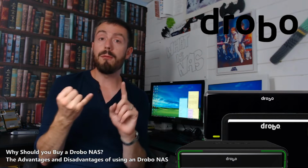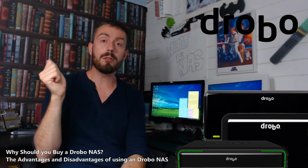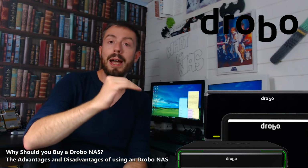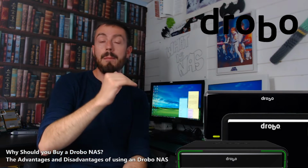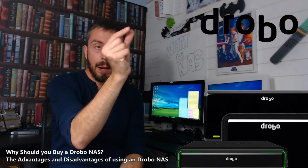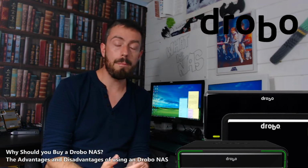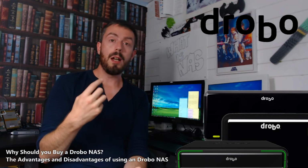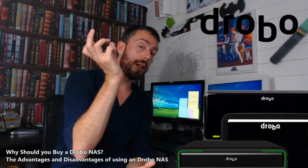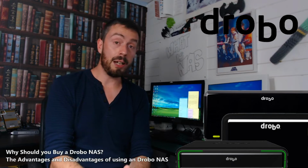And also, failure. Normally in a RAID array, when you've got multiple drives and a drive dies and you remove that drive, your read and write speeds will dip from around 90 to 100 megs per second down to about 8 to 10 megabits per second. Now, with a NAS, that means it's still working, but the system is using that parity that's been created to protect your drives to try to read and write the data, and it takes a very long time. Beyond RAID, if a drive fails, the device will give you 25 to 35 megabits per second read and write, and then you introduce a new drive, it rebuilds itself much, much quicker than other RAID-enabled NAS systems.